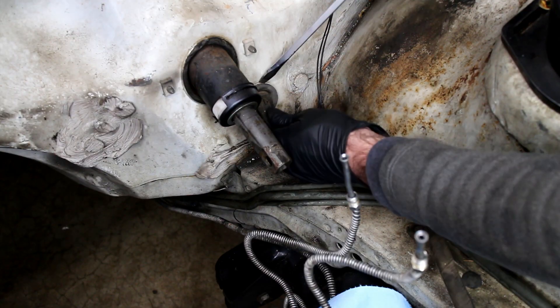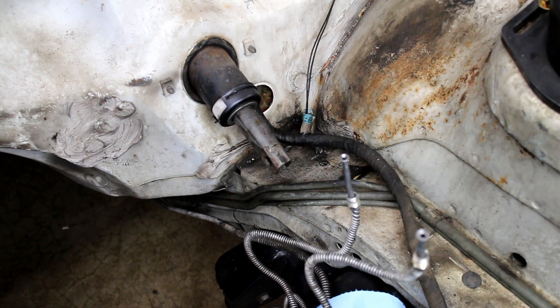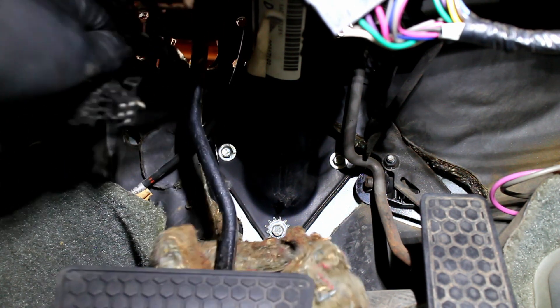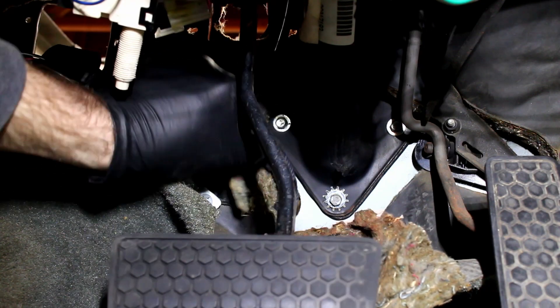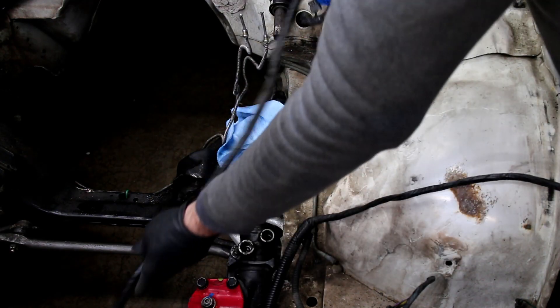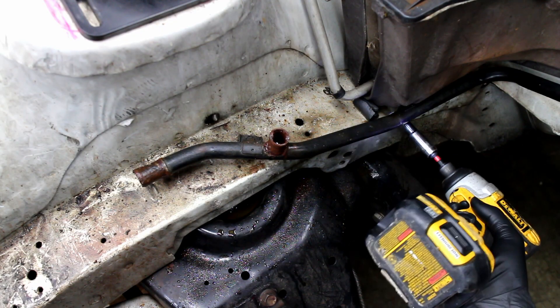Push the cruise control wiring and hoses into the car. The four nuts that hold the seat in place are removed. The cruise control pedal switch are removed alongside the brake light pedal switch. I can't get good shots underneath the dash, so bear with me here. Pull out the cruise control wiring. Unbolt the old heater system hardline.